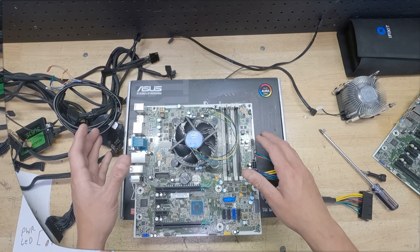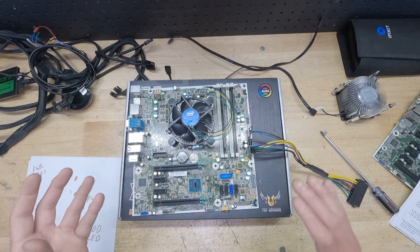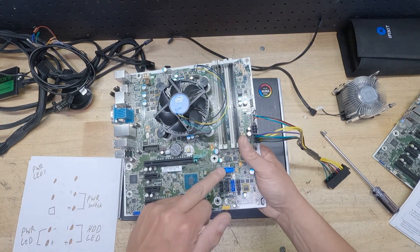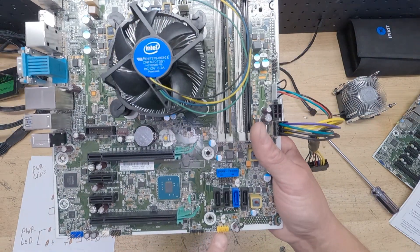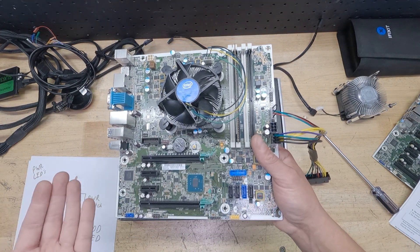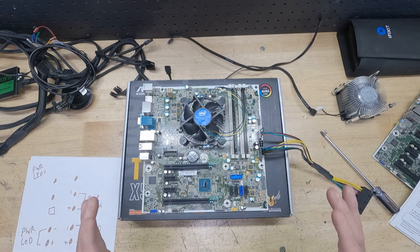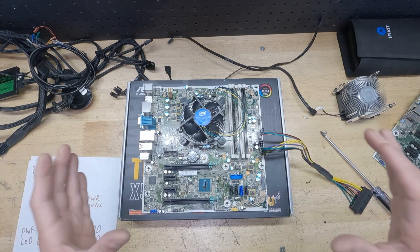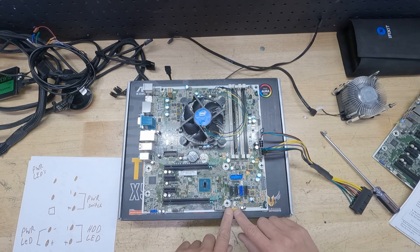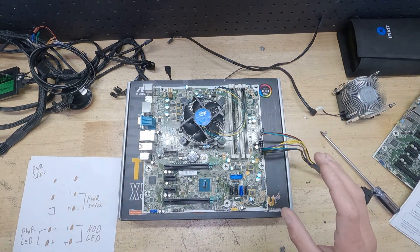Now let's talk about the front USB errors. The next issue you'll run into is once you do this, just like Dell, it's going to give you the front USB 1 and front USB 2 not working errors. What it's referring to is these two connectors — this is your USB 3.0 in blue, and this is your USB 2.0. The way they designed it, there's a signal switch and a ground switch and we've got to figure out how to short it. There are two ways to do it: the easiest way, and the more practical let's-do-this-right way. I've figured out the pinouts for these, so if you're not worried about having your front USB 3.0 or USB 2.0 working, this is the way you want to do it.